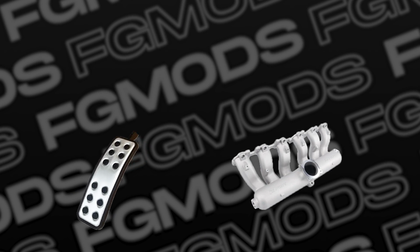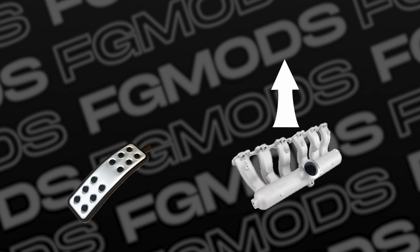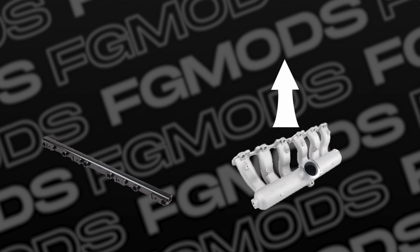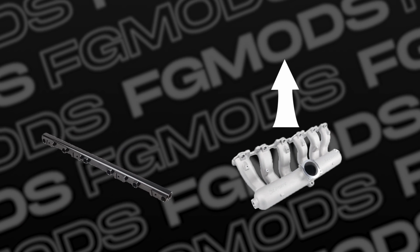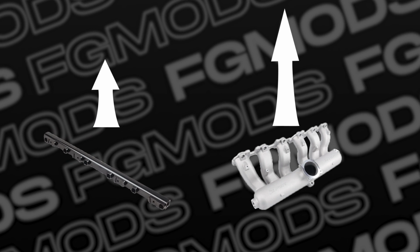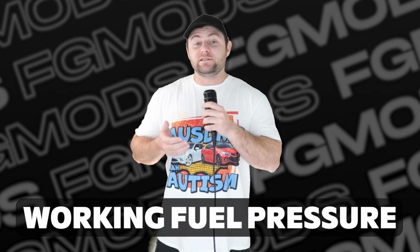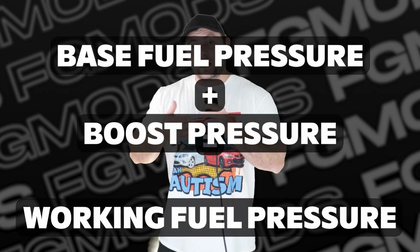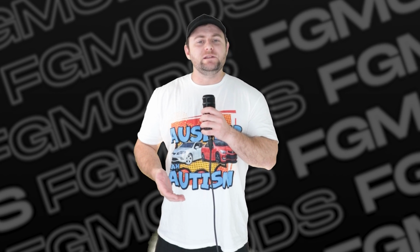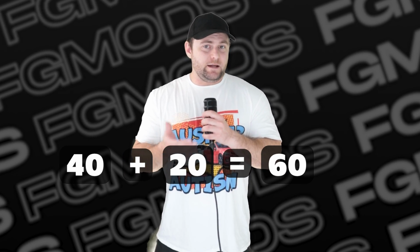When you put your foot on the throttle, you add boost, which pressurizes your intake manifold. As this happens, the difference in pressure between your intake manifold and fuel rail increases. Your fuel system then has to compensate for this difference in pressure. This is called working fuel pressure, and this can be expressed as simply base fuel pressure plus boost pressure. So if we have a base fuel pressure of 40 psi and then we're adding 20 psi of boost, our working fuel pressure is 60 psi.